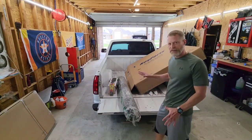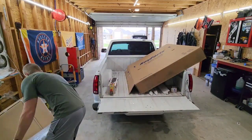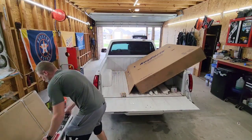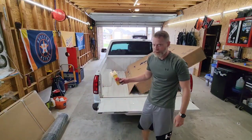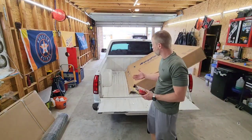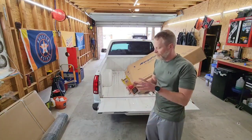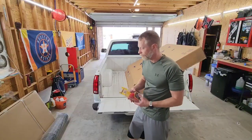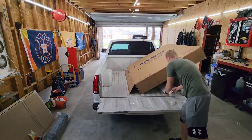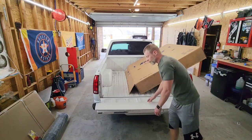The side walls are pretty good — they just need a cleanup, and that'll really finish off the interior and make it look good. I also picked up some bump stops. There's a crossbar on the bottom of the bed right above the rear end, and I don't want that impacting, so these will go inside the c-notch we just installed in the last video to keep the truck from bottoming out and hitting the bed.